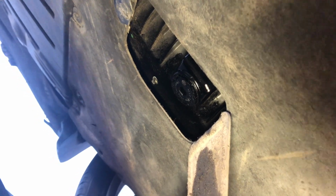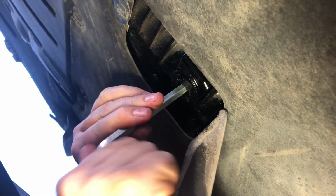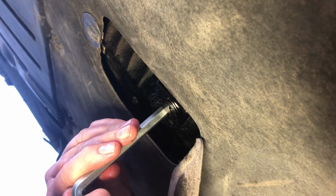Okay, so then we just get the Allen key and do this up. Now, obviously, because of this ratcheting clicking, it's not going to vibrate undone, which is a good thing. And it's got an O-ring seal, so it's a great seal. But it's only wanting a low torque in doing it up. So by using an Allen key, you're only going to get a low torque. So that's what you want. You're not going to get a great big spanner on it.